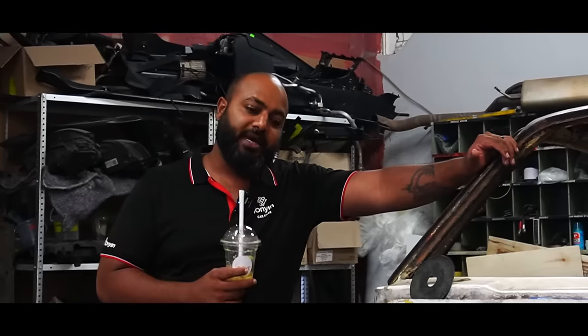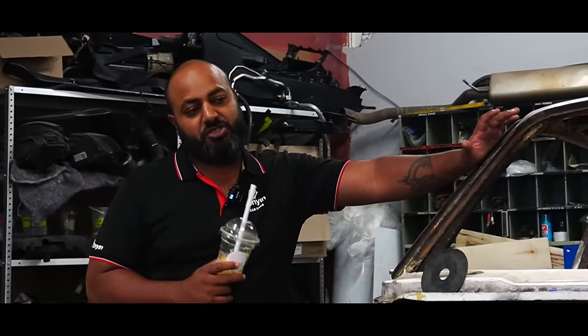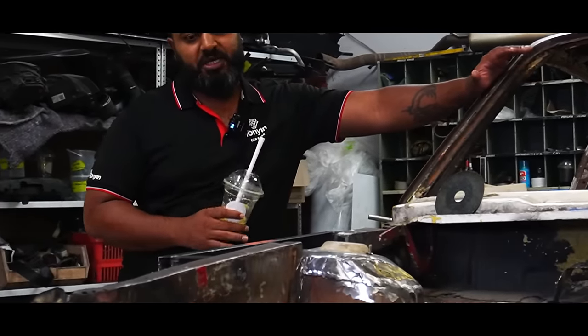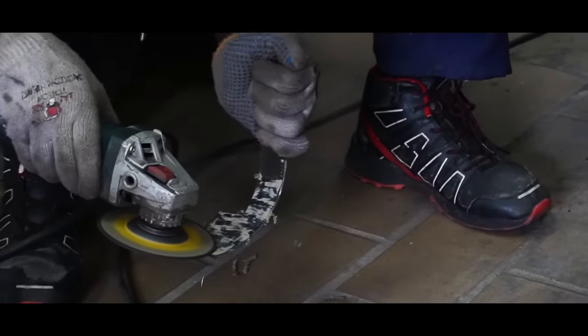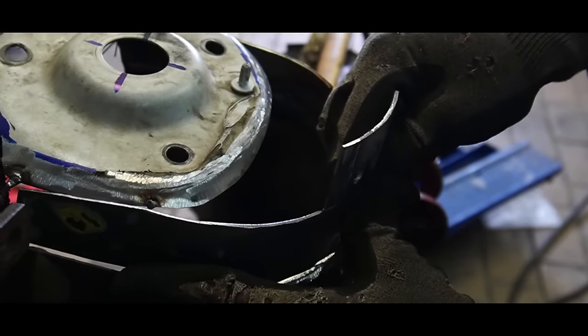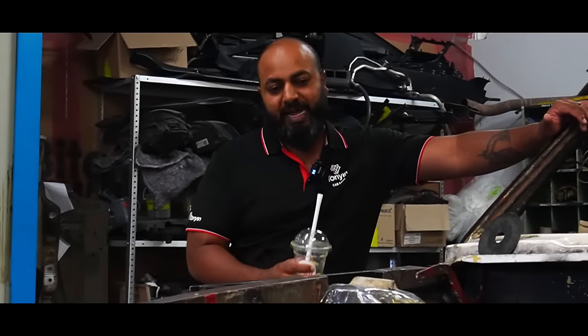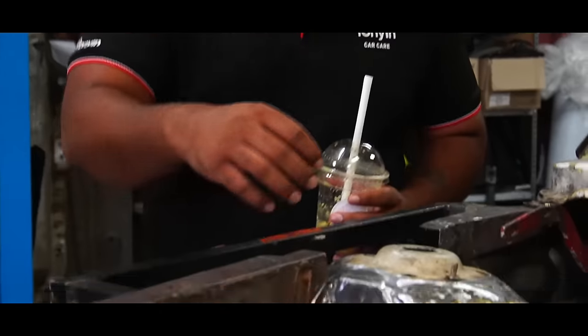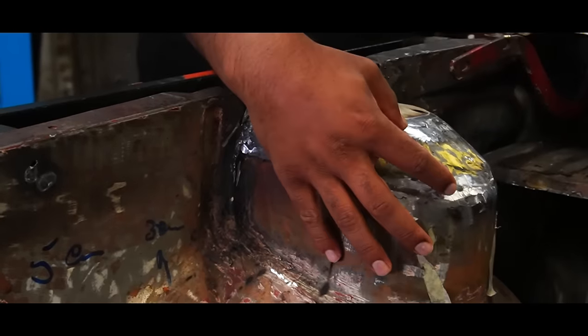So what I understand is we've repositioned the shock mounts to get better alignment and more sturdiness and rigidity when driving. Not only that, for positioning of the shock. Remember, on this car, we have to do a custom bag placement. So the custom bag has to be manufactured, because there is no bag for this car. The company that's making the bag for me needed us to move this shock mount 5 centimeters to the right.